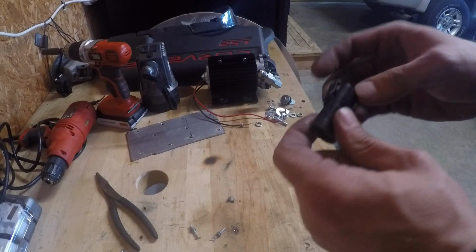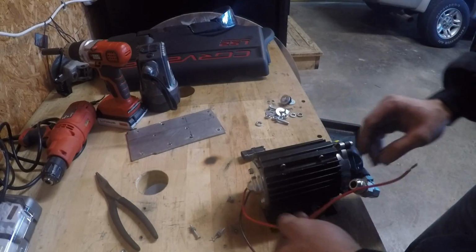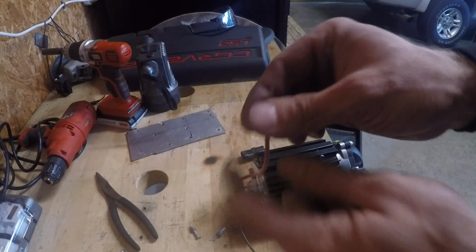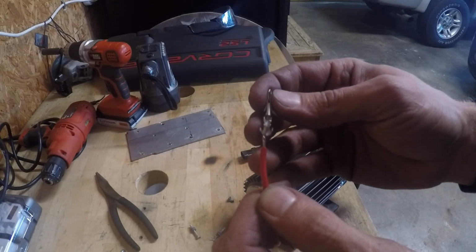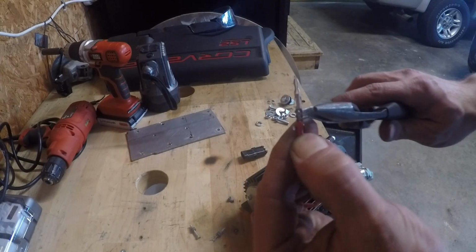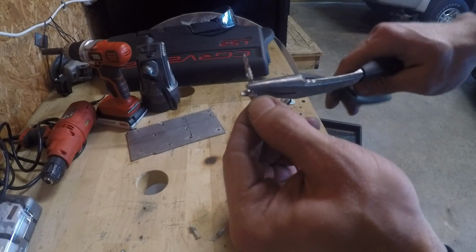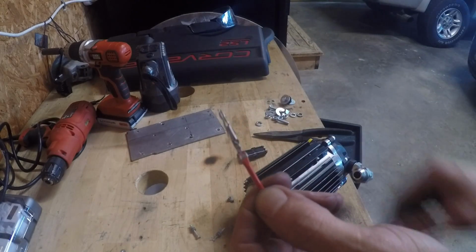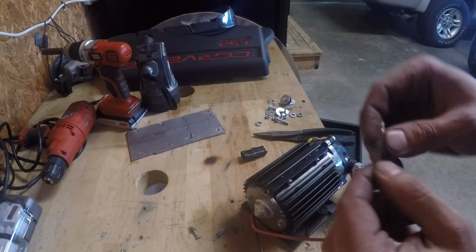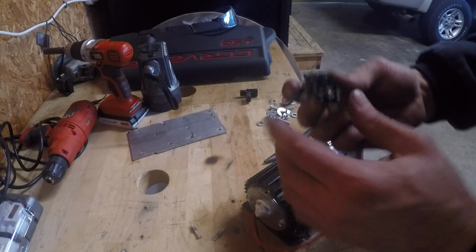So it's just like a factory install, and they're super easy. All you do is tidy up your wire. You slip this guy on there, and then you just crimp the little tabs in place. So you got my wire crimped in. You slide over your weather seal. Oh, where did I put that plug? So it fell on the ground, sorry.